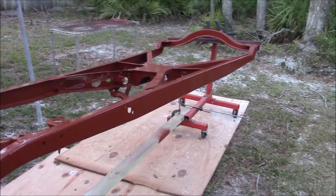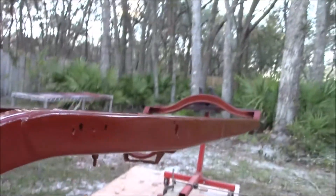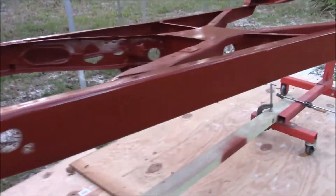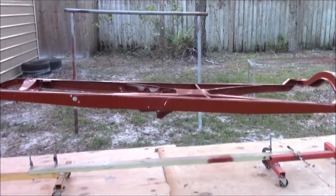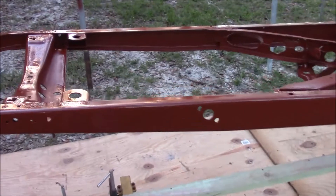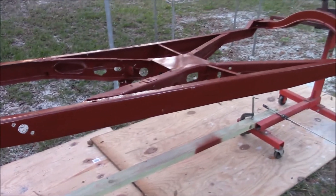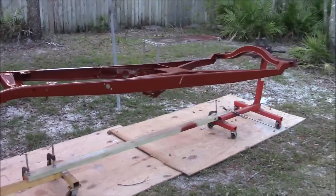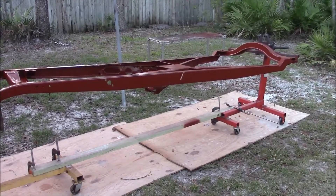There it is with a coat of epoxy primer over the body filler — the sides look much better, got rid of all the pits. When you're looking at the car with the body on top, you see that portion of the frame plus the open engine compartment, so I thought it'd be better to make it look nice. The next video should be the color coat — thanks for watching.